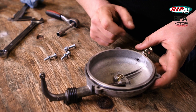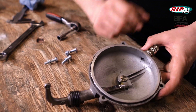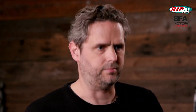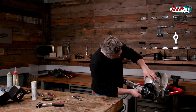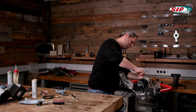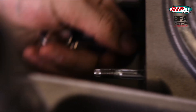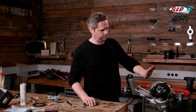Make sure the clutch cover has a large enough groove for the lay shaft so that it does not touch the nut that secures the lay shaft. I have completely removed the ridge that guides the oil — if you do not modify that, it may foul the outer clutch basket, so please double check this. Other than that, it's a standard clutch cover — not machined or anything. The actuating arm is not modified either. First test: does the clutch rub? I move the crankshaft up and down and, as you can see, it does not rub. A clutch cover that has not been machined means the clutch fits into a standard clutch cover.